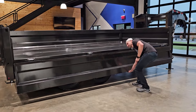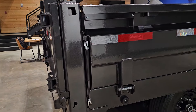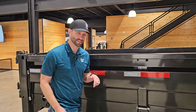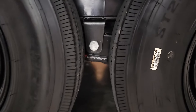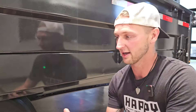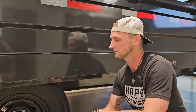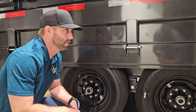One-handed operation — that's not too bad. Next thing that I want to show you, and another differentiator for us, is going to be our Lippert Slipper Roller suspension that we have on this particular trailer. This comes standard on our 7K and 8K axles. It's 7K suspension, but it's going to have about the same longevity that you get on the tandem dual 10,000 and 12,000 pound axles — very similar design. You're still getting it in your 7K option, which you normally don't get in the smaller GVW option. That's huge.